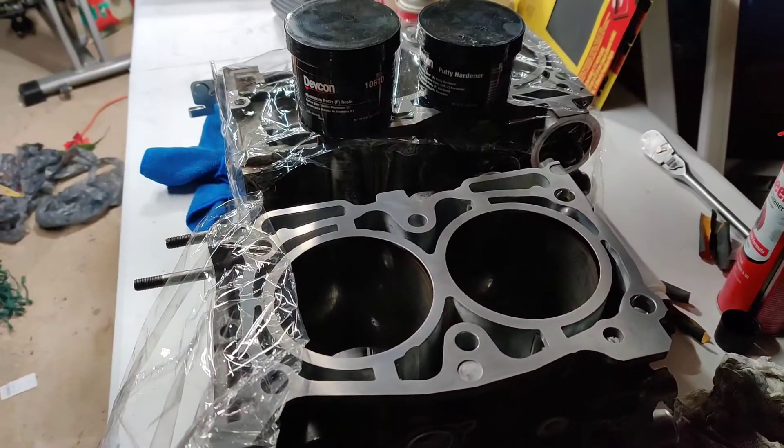It's really big with the Honda guys and they've had pretty good success with it. From a lot of digging around, I haven't found many Subaru guys that have done this — I think I found two. One guy did it with an STI or WRX block, the semi-closed deck block, but I don't think he ever ran the engine. He filled it in but never ran it. There's another guy that used an open deck block and I think he ran the motor, but I never saw any results of whether it was able to hold more power.